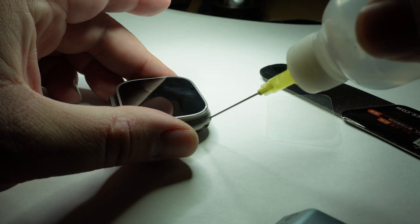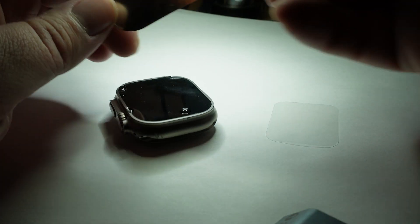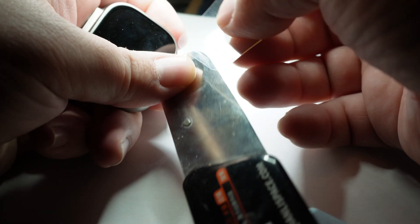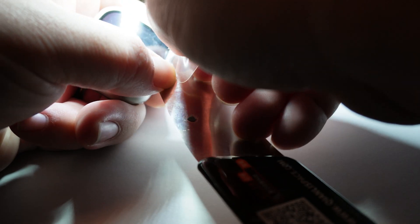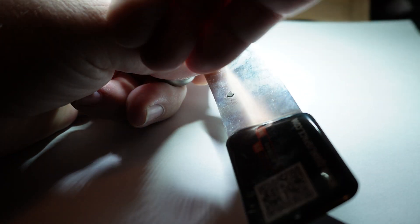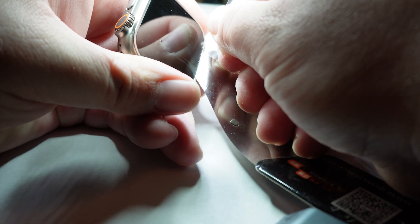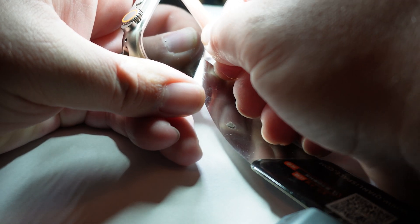We'll put some isopropyl alcohol down into the cracks in between the display and the frame. We'll take our little pry tool and wedge it down inside just like that. That gives us enough of a gap to insert the plastic and give ourselves a little bit of tension on the screen so that we can stick the plastic down in there. What we're trying to do is get the plastic to go under the frame, under the display, so we can cut around without damaging the display. I'm going to move the plastic back and forth until I find it slipping under the little bezel that's on the back of the display.